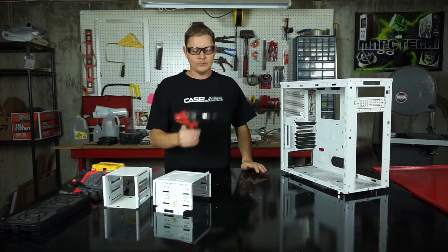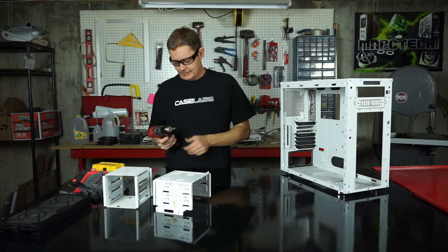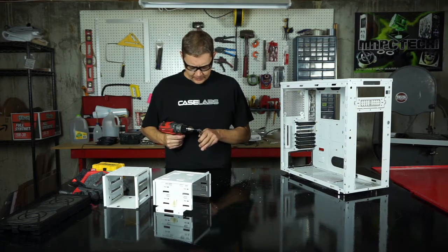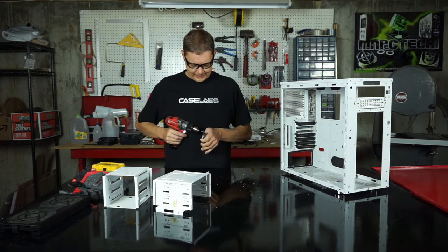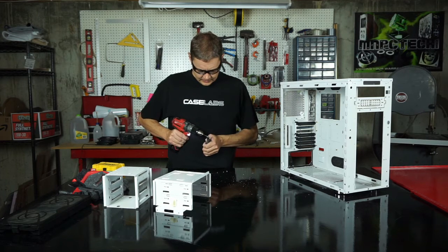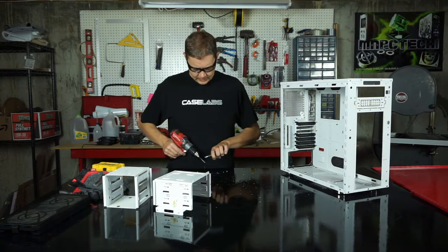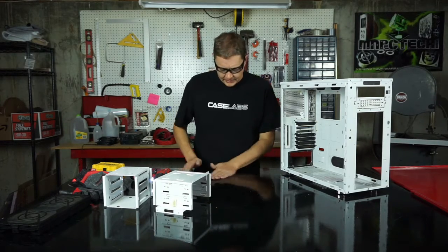After you're done with that, you're going to wind up with a drill bit with a whole lot of rivet ends, pieces, on it. Put your drill in reverse, and just grab a couple of them with your pliers and very slowly work those off and clean them off your drill bit. There we go. And like I say, look at all the trash we made.